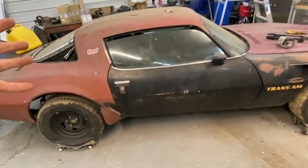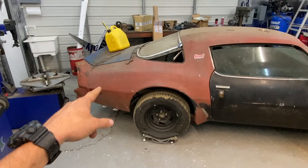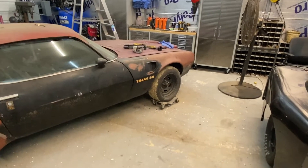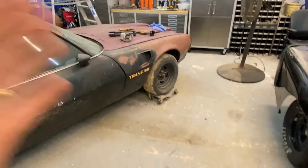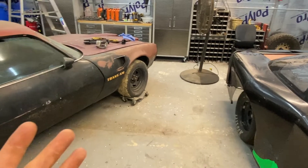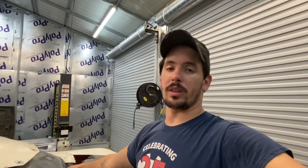The plan is to use this for the other car. The floors are rotted out, trunk pans are rotted out, frame's got a little rust, front subframe bushings are gone, the whole front suspension needs to be redone, brakes are garbage, missing half the wheel studs, got drum brakes in the back. Basically everything would have to be redone. Priced out brakes alone on the front - rotors, hub bearings, calipers - that alone was $700. So I got this whole thing for a steal: $2,000.